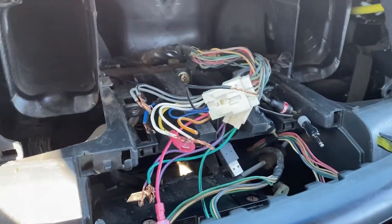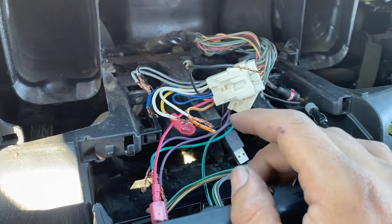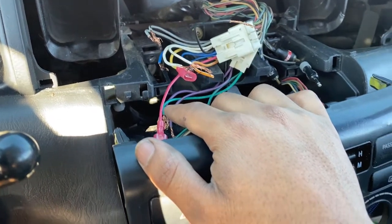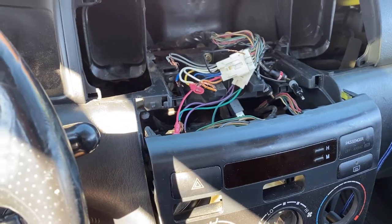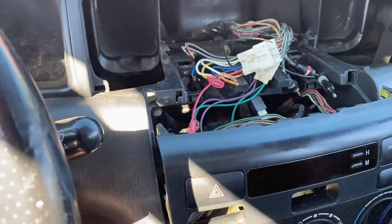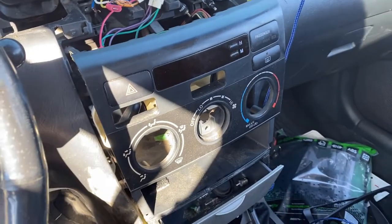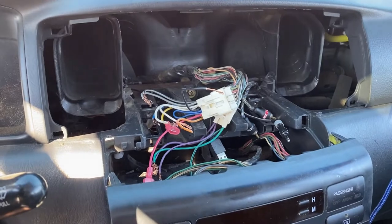It took a while because it had all electrical tape. The orange one I'm not gonna use — that's for video. The yellow and the red ones I am using. One of them has direct source power, and the other is for the ignition — it turns on when the ignition is on, which powers the stereo. I'm gonna put all the male connectors on these, and on the stereo side I'll put all the females, then plug it up and test it out.